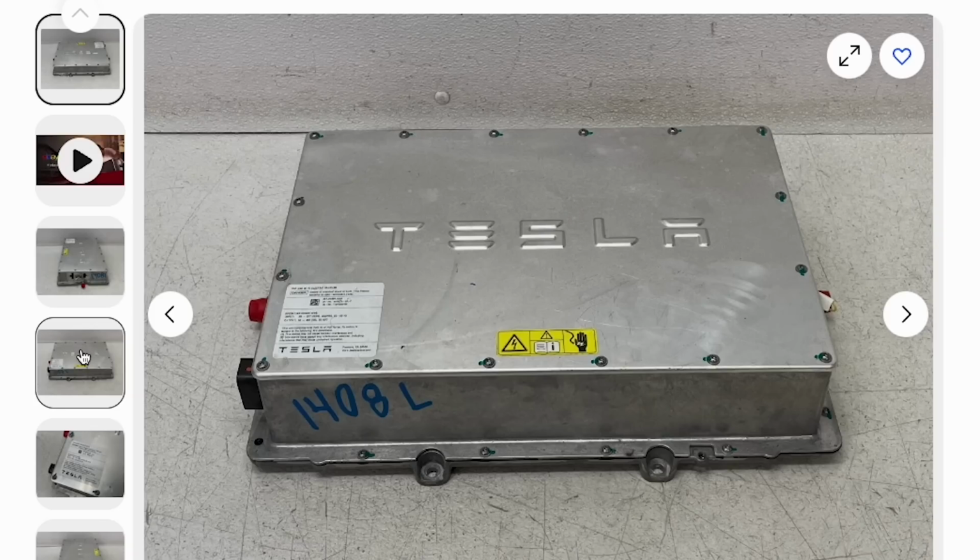Now, in the meantime, I was still taking a look through some web forums, and I did find something that caught my attention. There was one comment where somebody's supercharging didn't work. They had to replace the fuse in their battery, and after replacing the fuse, the supercharging did work. Well, that sounded a little weird to me, because what's the main fuse have to do with supercharging?